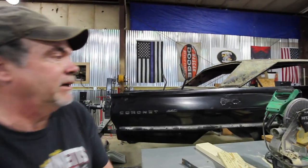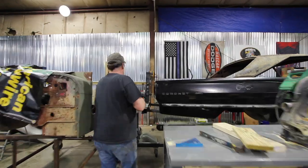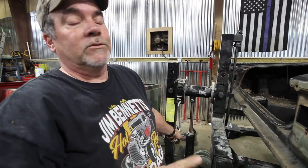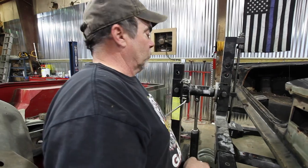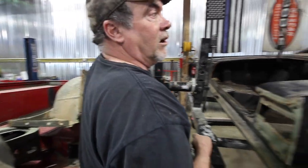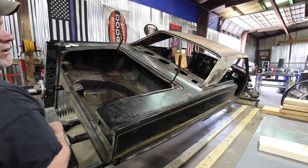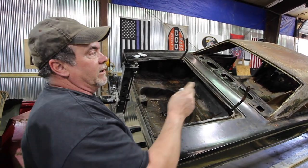It's a train wreck out here right now, but I want to show you why we do this — the reason being, we're old. I've got these rotisseries from Weaver Equipment. I've got two more coming because we've got enough cars for three rotisseries. There's a real good gear reduction in here — you get the car set upright and you can turn it with one hand with very little effort. I can put this car completely upside down or on its side, whatever I want to do.